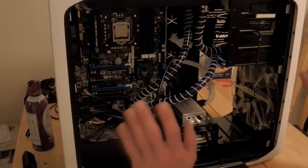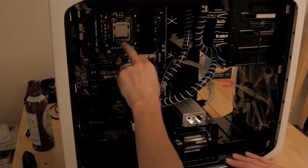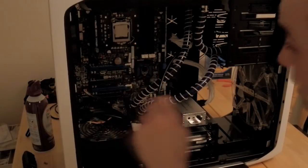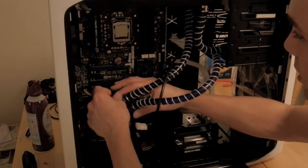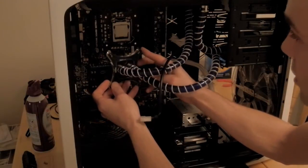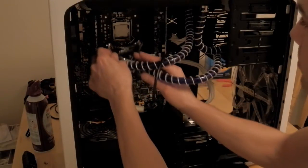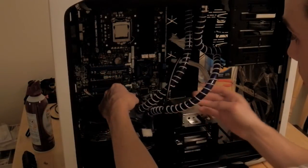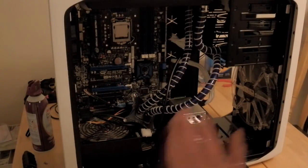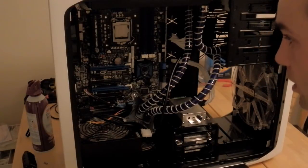So we're back — a little pickup. The motherboard is in, processor is installed, just got to put the thermal paste on it. The radiator, reservoir, and pump are installed. We can just put the back plate on, apply the thermal paste, and go from there. Pretty much everything else is set up — I have not plugged in the 24-pin power yet or the graphics card, and that's about it. Coming along pretty nicely, not too much left to do.